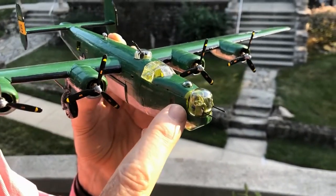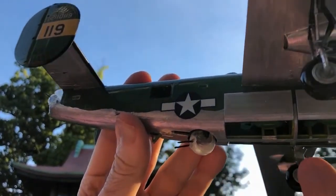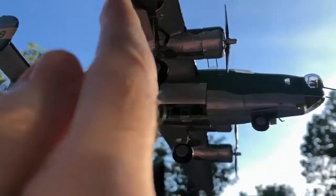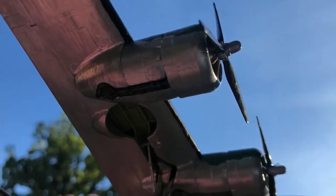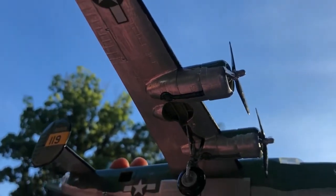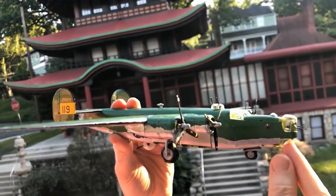Here at the front is the front gunner. Underneath you'll see the ball turret. The bomb bay holds eight 1,000-pound bombs, and it was front-weighted, so there's a wheel in the front — it landed with its weight on the front. I want to draw your attention to these linear structures just below each engine. They're called the supercharger, and that is what my father worked on. The supercharger was a series of pipes that circled around each other, putting the cooler outside air in contact with the hot exhaust air, increasing the temperature of the outside air funneled into the engine, making it operate more efficiently at higher altitudes.